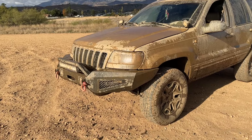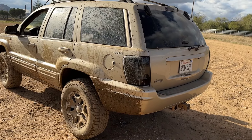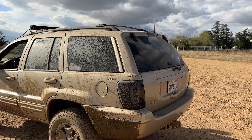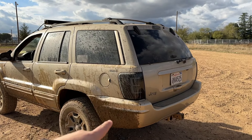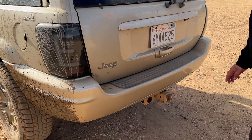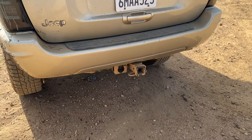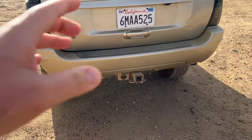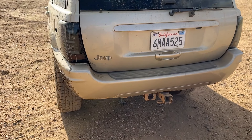On the back, he did upgrade the tail lights and the third brake light as well, matching the smoke. It looks way better than the stock and these actually work, compared to the stock ones where you always get bulbs that go out. Something else he did — his didn't come from the factory, so he ended up installing it and cut it with a knife. On the back of the bumper, there is a line that shows you where to cut, so you can follow that guide.